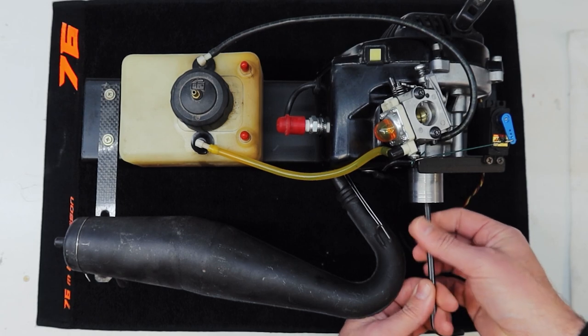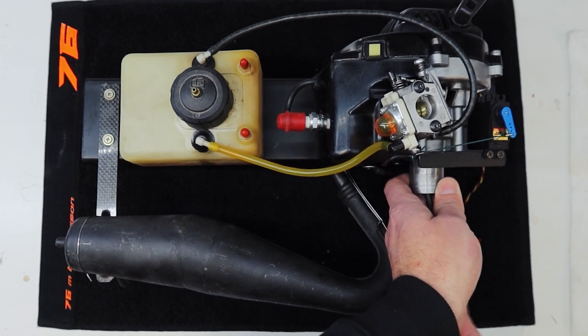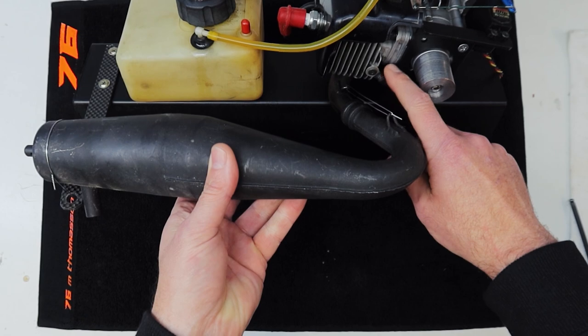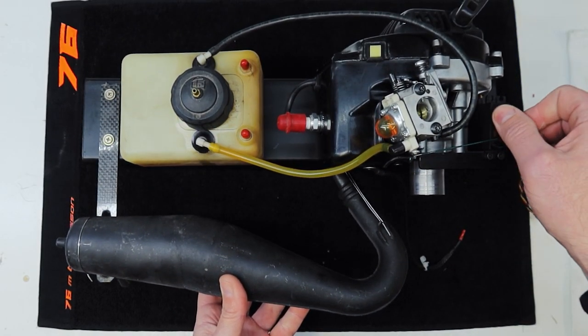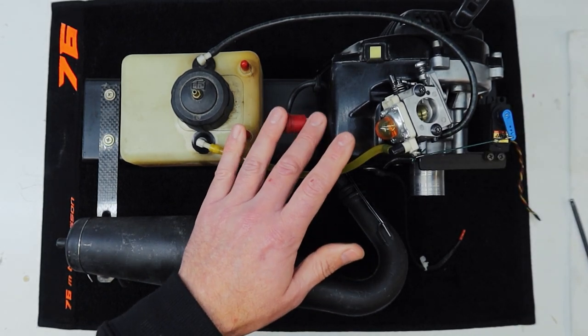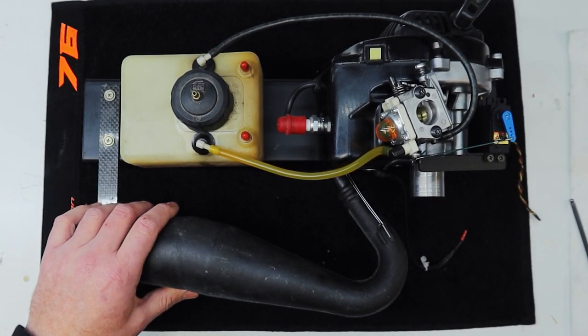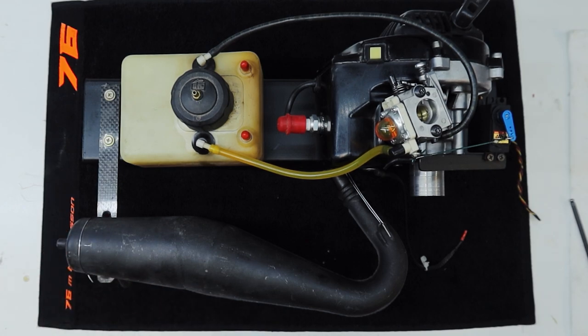It'll really help for some future videos that are coming up, that one. We just got the temperature sensor here on the 7PX and just an old servo I had laying around just to operate the throttle there. Really worthwhile setup. I think in the future I'll be running all my engines in on this rather than clogging up a nice titanium pipe. I'll be oiling up this dirty thing and just running the engines in here at home.